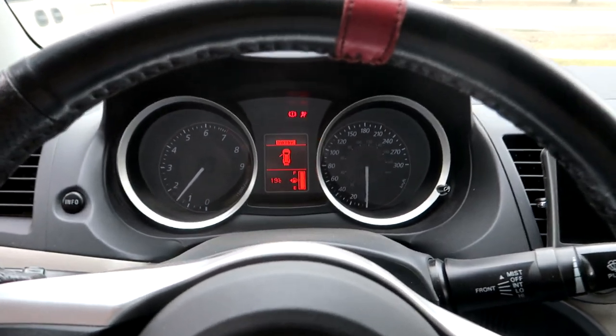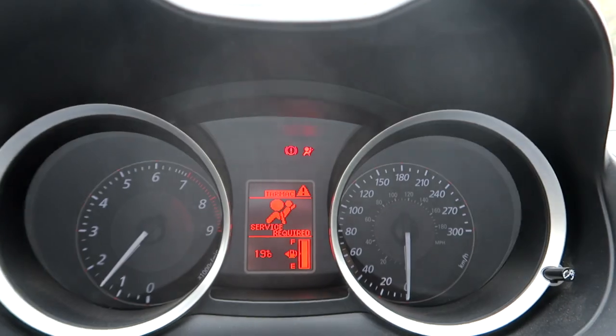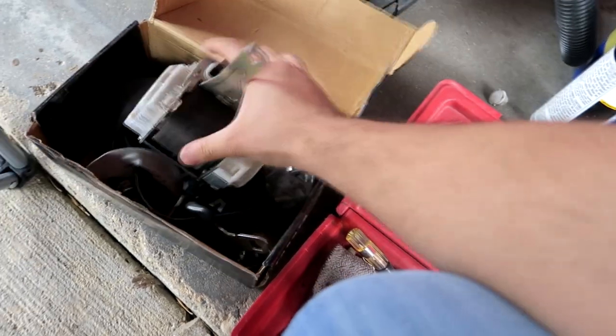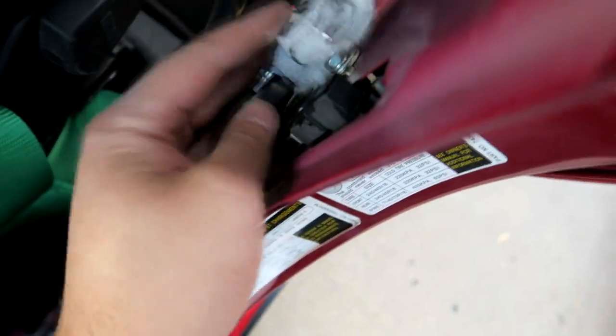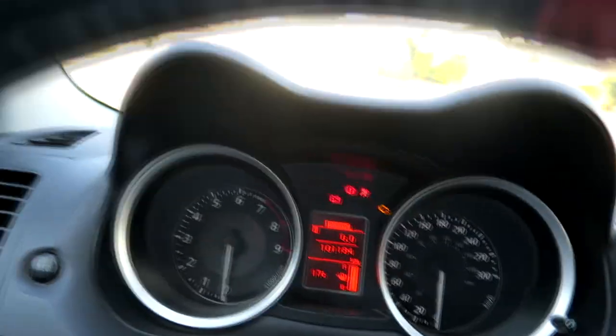There is no exhaust on this. Oh, there is an airbag light. Okay, so because there's an airbag light, we're gonna have to put this original seat belt back. My original issue was where I was gonna mount it, but we might just zip tie the whole thing and mount it back just so we can plug in the airbag sensor, so the car thinks everything is good — and we'll have to hide it inside the car. So I put back the OEM seat belt and wrapped a rag and a zip tie around it just so it doesn't rattle inside the trim. All the airbag sensors are plugged back in and I was able to hide it.